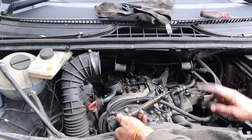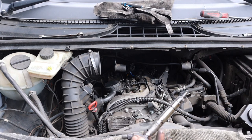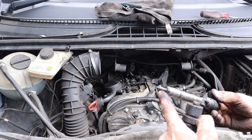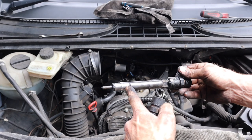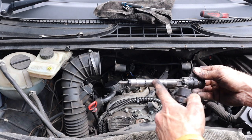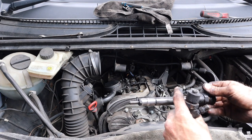All four are out. I've got two copper washers that came out with them. Give these a clean up. You can give the body of an injector a wire brush, but don't do anything with the tip end because there are tiny little holes on the end — it's easy to clog them. You can give this part a wire-wheel or wire-brushing to make it easier to go back in, but don't touch the tip. You can put a little bit of copper grease on them when you go back in.